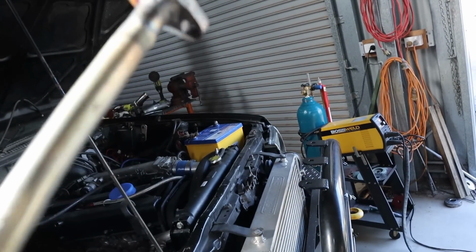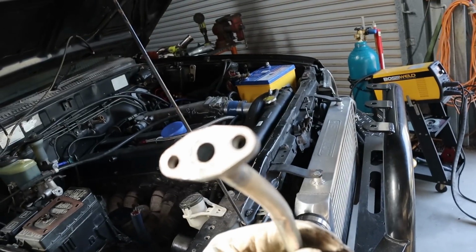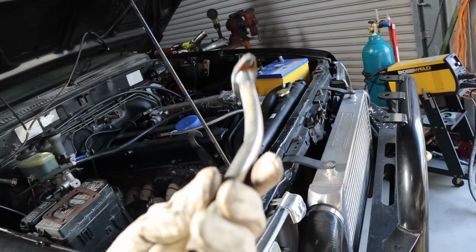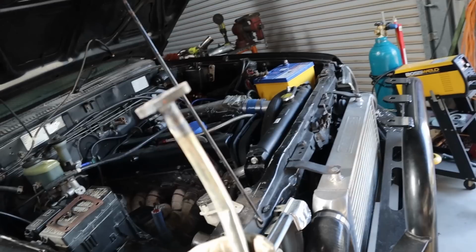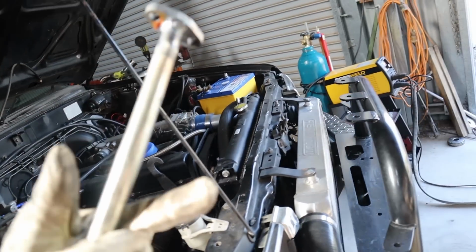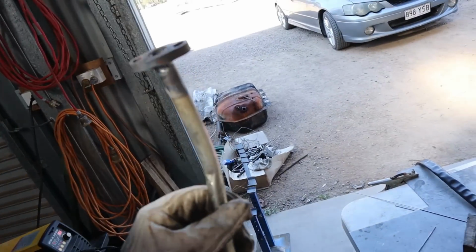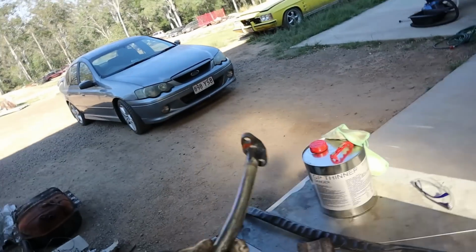So I just welded that up. Both of these materials are really old and dirty, which made for a very hard thing to weld, but it's gonna do fine for a turbo drain. And that should be plenty big enough for a ball bearing turbo as a drain. I can't fit any bigger tube between the runners anyway, so that's how it's going to be. So I'll wait for that to cool off a bit. I'll clean that up with a bottle brush, and then I'll give it a lick of paint, and then you can go on the turbo and go in.